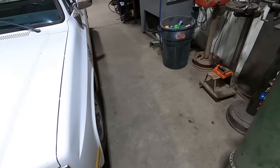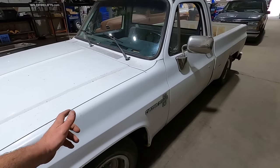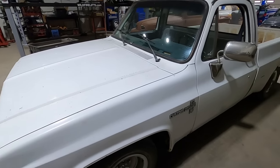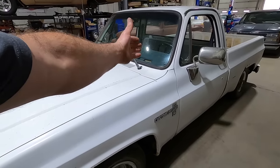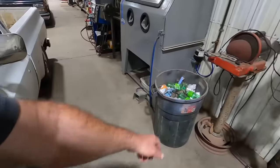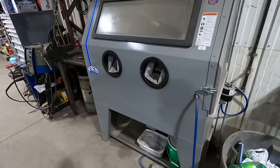The old white Casper — the 4.3 is burning oil. I think it's got a vacuum leak, it revs really high. I don't know what we're going to do with this thing; it didn't hardly get driven last year. It's not a bad little pickup, but it needs an engine. I'm torn on whether to put a 350 in or LS it. Comment below what you think we should do — do we put a 6-liter and a 4L80E in it, or just drop a 350 and leave the Turbo 400 behind it? It needs some rust repairs too, but it's actually a pretty good pickup.